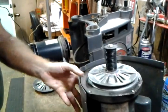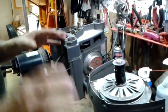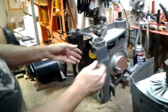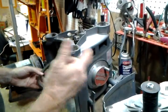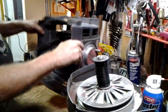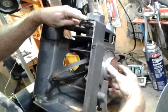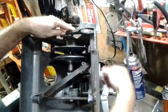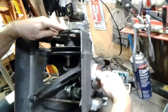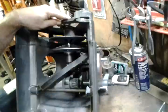Let it sit for a few hours anyway — maybe overnight — and let the penetrating oil get in there and dissolve that varnish. If you're able to, you can try changing your speeds and see if it moves. When you change speeds, you should see this shiv change position with the speed control. You can do that while you're rotating the shaft by hand.